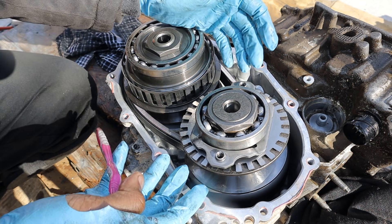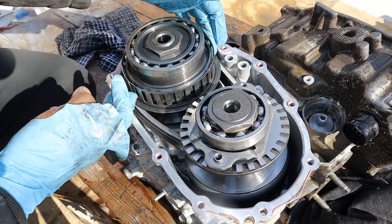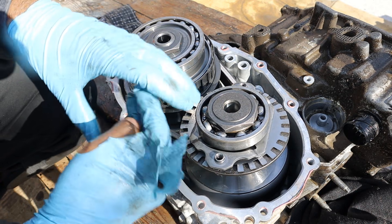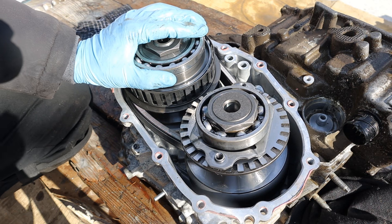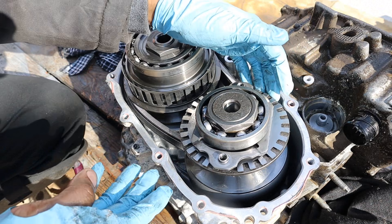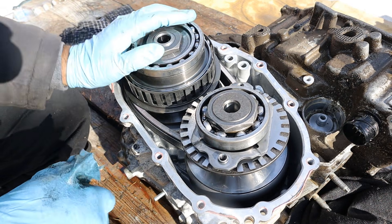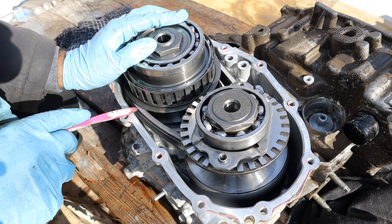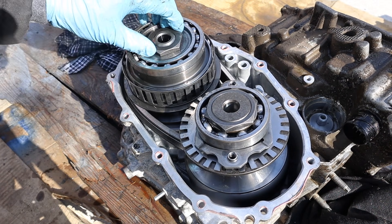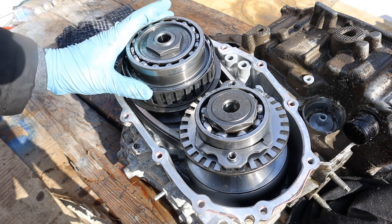The way this transmission works is by varying the diameter of where your pulley is sitting on the input and the output side — you can achieve a drive ratio. It's not really a gear ratio, because you don't have gears nestled together the way you do in an automatic transmission with a planetary gear set. By moving these variators together you can get a larger diameter. In this particular scenario, if your input is a very small ratio and the output is very large, it's kind of like a first gear scenario where your RPMs are pretty high but the output is pretty low, giving you a nice torque multiplication. The nuts on these shafts are very large and I don't have a socket to fit over them to remove them, so I'm going to have to use a different tool.